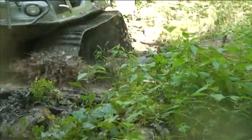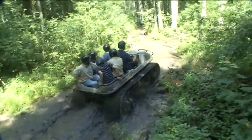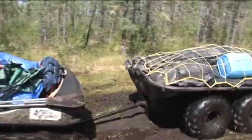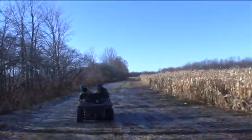Trail riding is a great way to get you and your team out and explore the outdoors. Trails are at times rutted or washed out by heavy rains. With its low ground pressure and full six and eight wheel drive, the Argo is an ideal vehicle to navigate through challenging trails. Care must be taken when encountering rutted areas — depending on the depth of the rut, you could high-center the vehicle on the skid plate. It is best to straddle high spots or, better yet, avoid these areas.